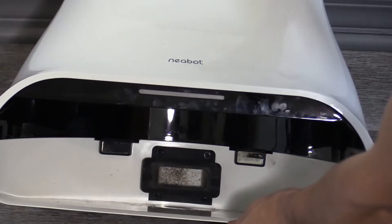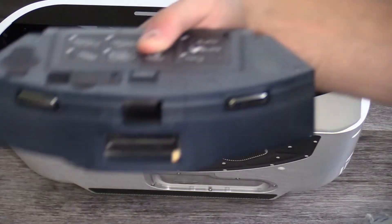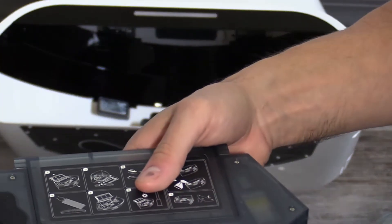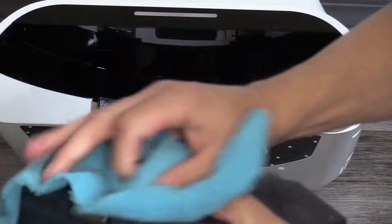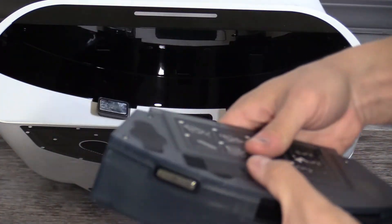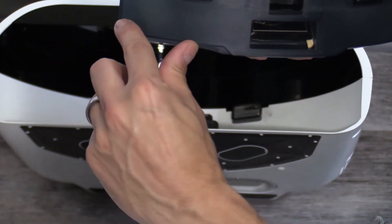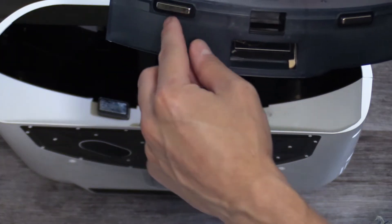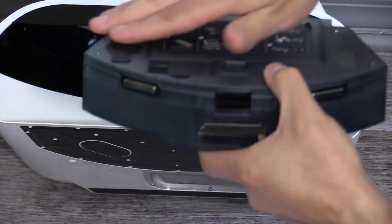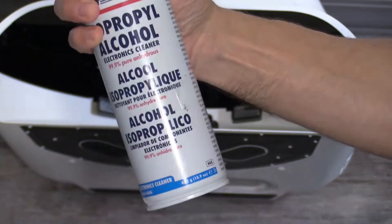It's probably because of a bad contact. The charging pads are on this dock — I cleaned out the unit, it's all dry. I'm going to go ahead and clean the outside right here and make sure everything's clean. If this does fix it, then we know what to do to prevent it from happening again: simply fill it up 25% of the way with water instead of overfilling it, and make sure it's completely dry on the outside so it doesn't get wet on the charging pad.